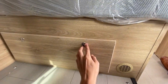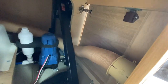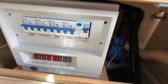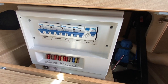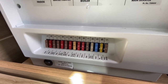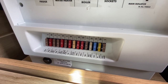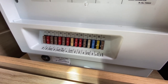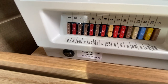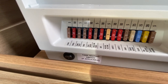Underneath the rear travelling seats you've got your water pump and another access compartment to access it from the side. You also have all your RCDs — your main trips for your sockets, heater, boiler, water heater, fridge and charger. Below that you have your 12-volt fuses. It would be a good idea to buy some spare fuses — 5s, 10s, 15s, 20s and 25s — from Halfords and carry them just in case. Below that you have a small rocker switch which is your tank heater: in winter or colder climates, put your tank heater on — it just puts current through the water to stop it freezing in the tank.